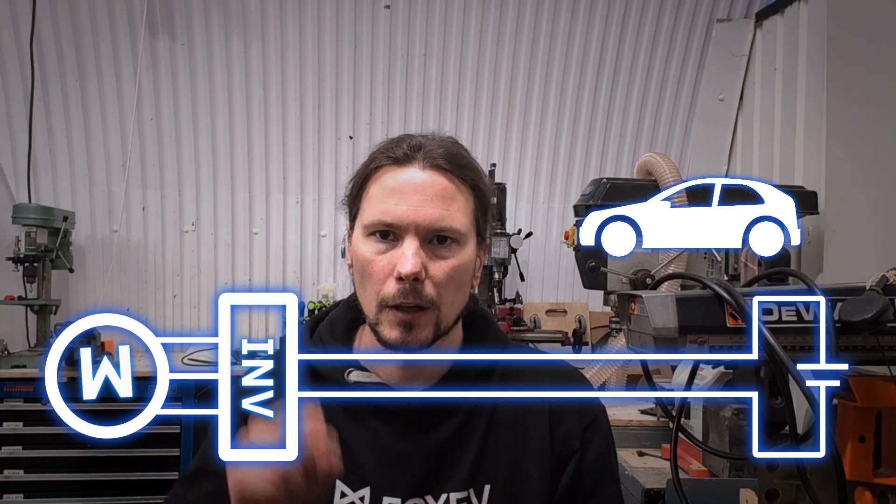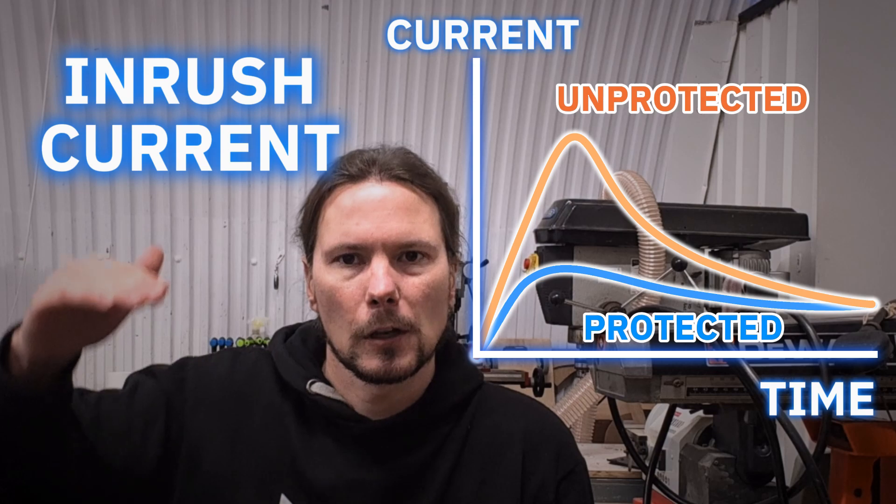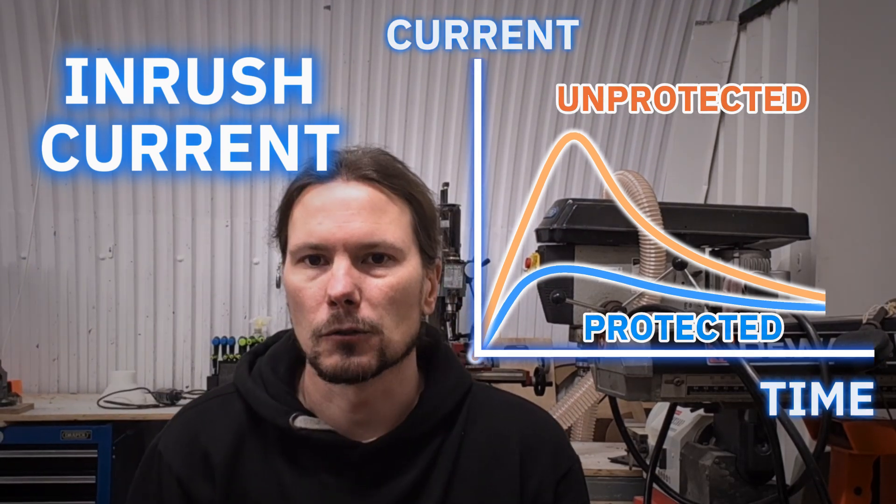I'm going to tell you about some devices you'll find on a high voltage bus and some important concepts. In an electric car you have a battery — plus and minus — and two wires that go to the inverter and to the motor. There are two key concepts: pre-charging and shielding. Pre-charging means the inverter has capacitors in it, and when you connect the battery to the inverter there's an inrush current you need to minimize. So there's a pre-charge circuit that connects through a resistor first, letting the capacitors charge up slowly, then you close the main contactor and you can drive. You can hear the relays clicking on with about a two-second delay in most cars.